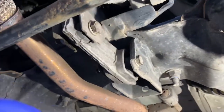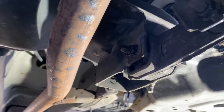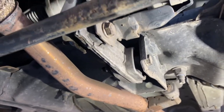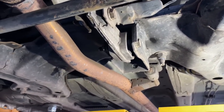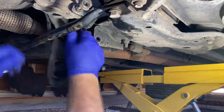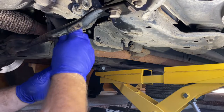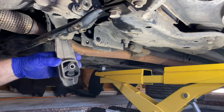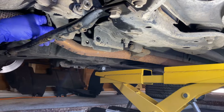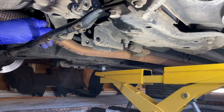The next thing I'm going to do is take off this gearbox mount here - looks like two bolts, I think there are captive nuts on the other side, 16mm heads. Get that gearbox mount out. Just two bolts - there's the lower gearbox mount. We should have a bit of movement on the engine now - yeah, he's starting to move a lot, so we're starting to free things up.